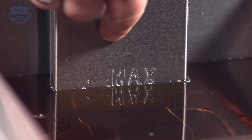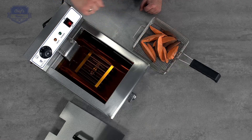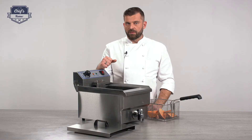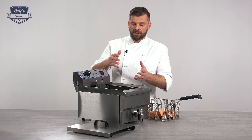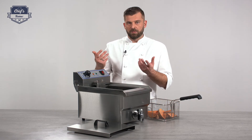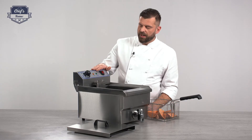There's a marking on the cover of the heating element that shows you exactly how much oil you need. My personal advice is to check the oil level regularly, because when it goes below the minimum mark you may damage the heating elements — it will overheat, trip the safety, and you'll have to wait for it to cool down, unplug it, and reset it. The reset button is at the back.